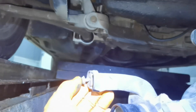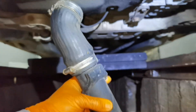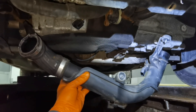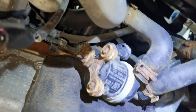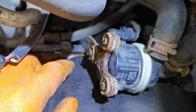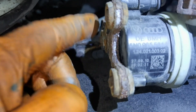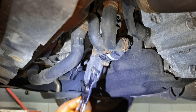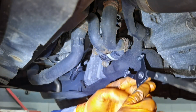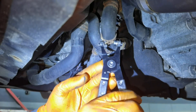Here is the first screw and here is the second one — don't worry about them falling out because they won't fall out from the tubing, as they are held in place by a little rubber over the plastic. After removing the intake tubing, my recommendation is to not remove the three screws from the bracket securing the auxiliary water pump in place. Instead, remove this single screw from the top which secures the entire bracket to the engine. Pull it out completely — you'll have more room to work and in some cases this can prevent the other bolts from breaking or snapping if they are very rusted.